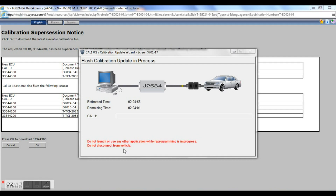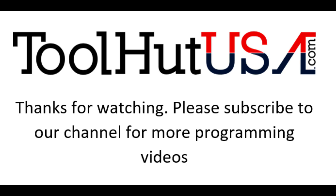You're going to have a prompt for turning the key on and off a couple of times, and then it's going to start. I apologize for not having that part recorded. Once it's completed, you'll just get a message to turn off the key as well, and once you do that you're pretty much done. It does want you to put a label on the ECM — I typically don't, but if you've got labels you can put them on.